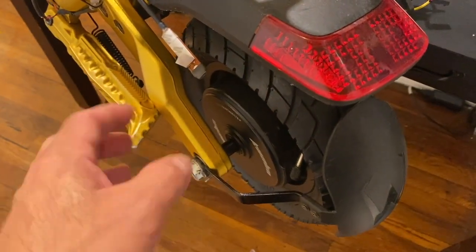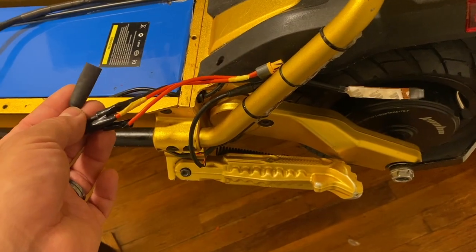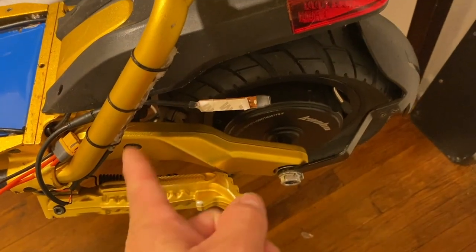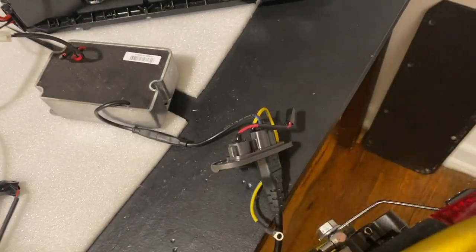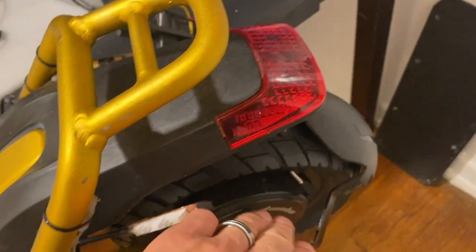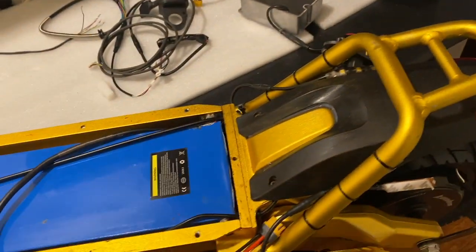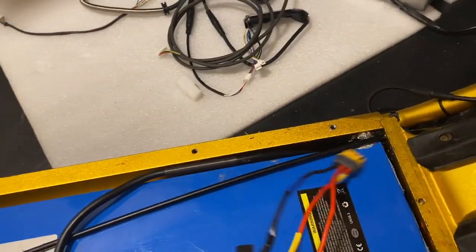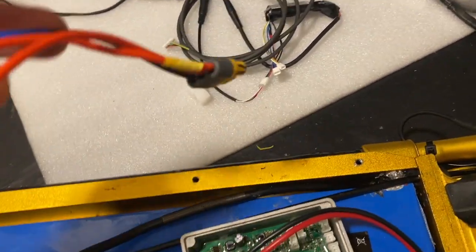So the connections I'm going to be making here — instead of rotating to the front, it's going to go to the back. If you were to install this motor in the 9BotMax with this side down, it will rotate towards the front. So I hope that's clear enough. It's important to pay attention to the connections. As I explain, the rotation — this motor is going to run backwards when I demo it, but if we flip the motor it's going to run in the proper direction.